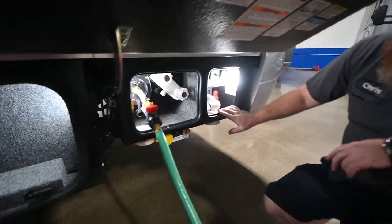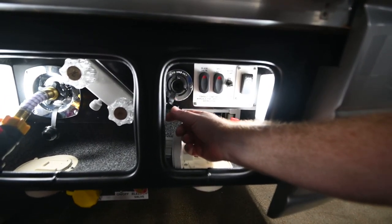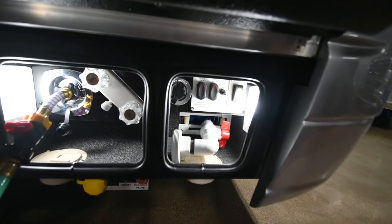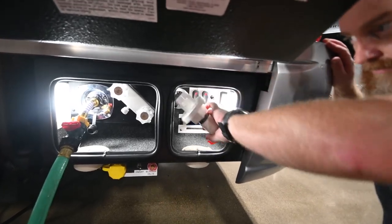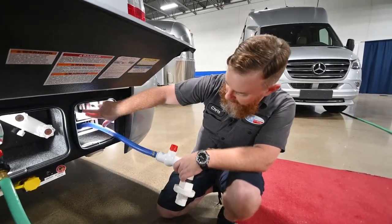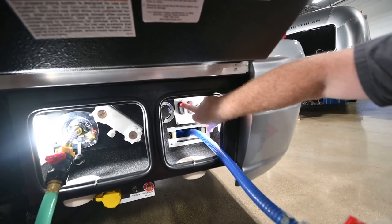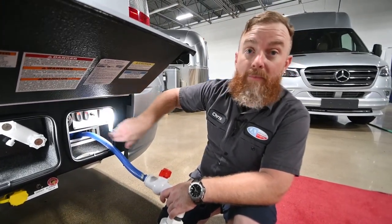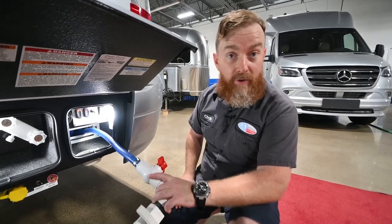Next to that is your waste clean-out. In here you have a little water port that allows you to attach a water hose — this is your black tank flush, so you can put water into the black tank as you're flushing it out. The black tank is the one the toilet empties into, and that'll help you keep it a little cleaner. When doing your waste clean-out, first pull the hose out straight, then parallel this red valve to open it. Hit the switch on the black valve and push it until it opens — you can hear it when it's fully open. Always begin with the black tank valve, then turn a pump on and it's going to pump the waste out. This is a macerator pump — kind of like a garbage disposal — it grinds what's in there to help it come out of the hose better.